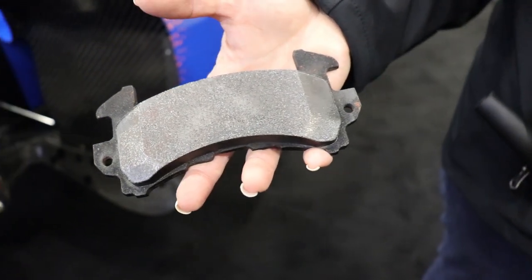Just to put it in perspective — Kyle Strickler, open wheel modified, at Charlotte two years ago on a real dry slick track. We actually made a pad change, made a friction change before the main event. Kyle wanted to put 80s on all four corners. Kyle counts on the brakes just like he does the motor and the shocks. With that 80 compound being a real light compound and the track being really dry with a lot of horsepower, it was able to give him just enough bite to stop the car straight and not free the car up. If you were to run a 97 or a 13, now you're fighting a loose condition on a dry slick track. Just different compounds, different situations — brake pads can make all the difference in the world.